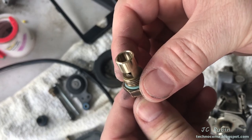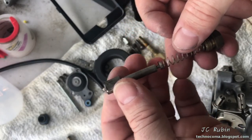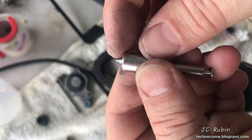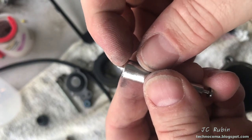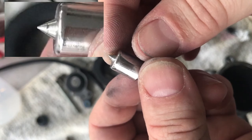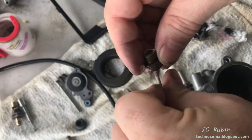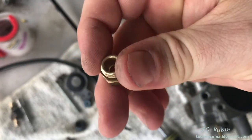This piece is now shined up on the inside — the seat inside is also shined up and we're going to put this back into service. This piece is for the enrichener — I'm going to do the same thing, polish it and clean it up. This is another piece cleaned up but it's no spring chicken. You can see as it sits in position the unbelievable amount of vibration in this motorcycle ultimately causes wear at the seat — you see that little halo around there. Still good but something to monitor. If it gets worse by the next time this is broken down I will have to replace it. We'll pull it and put it in the clean pile — that includes the spring also cleaned up.